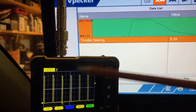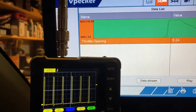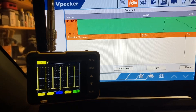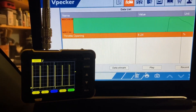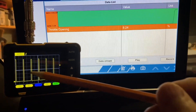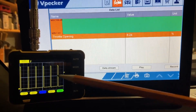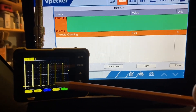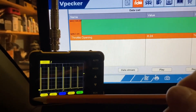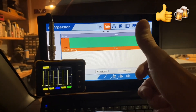As I release it the closed drive does come back, plummeting towards the closed position, and now it's here just to maintain the target position of the throttle. So we've got detail on throttle actuation, as opposed to last time which was throttle position sensing. Keep in mind the width of the pulse is a function of the rate you're asking for — throttle actuation either open or closed — and the polarity you're looking at will be a function of whether you're on the open side or the closed side of the motor drive circuit.